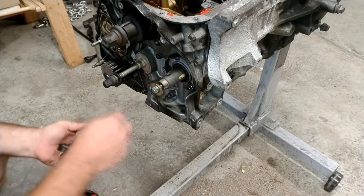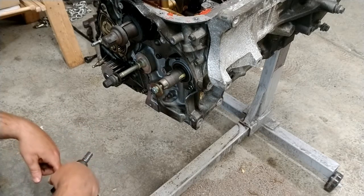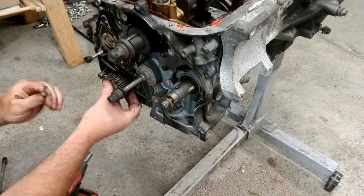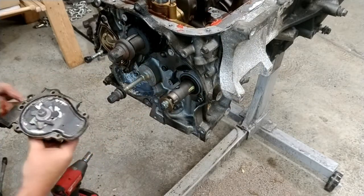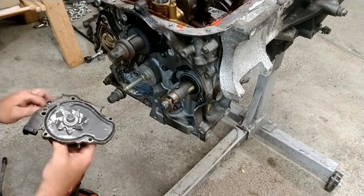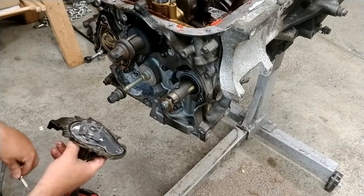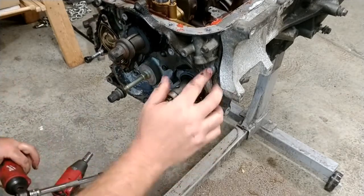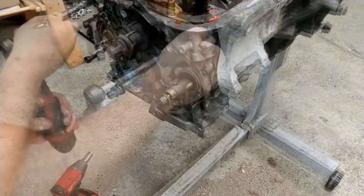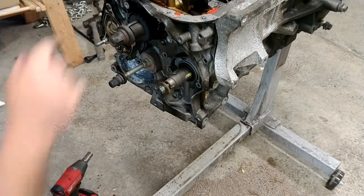As always, we'll store all this together and make sure it all goes back to where it's supposed to be. I'm going to go after the water pump now. And there's your water pump. That's what happens when you run an engine with well water — you're going to start getting calcium deposits built up in the water system, so that's not a good idea. Most of those bolts were the same size, and those two long ones came out the top — that should be pretty easy to remember.